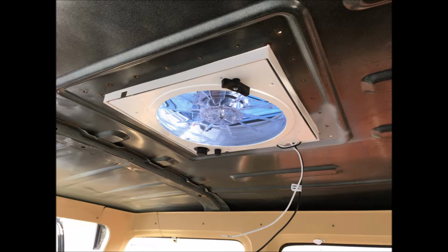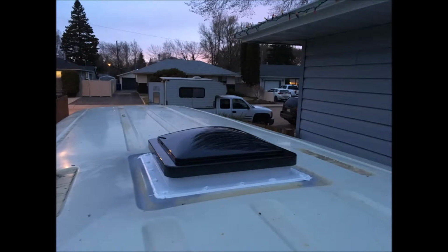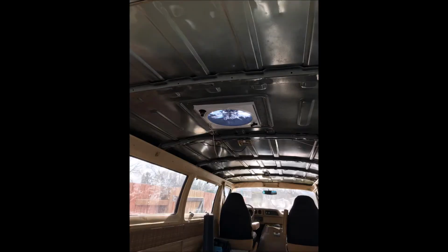After scratching away the rust, I primered over it to make sure that it wouldn't rust again, and sealed up any holes that were there, but it was actually fine metal underneath. It can be intimidating to see rust like that, but basically if you can't poke your finger through it, it's fine, and it will hold the vent that you need.